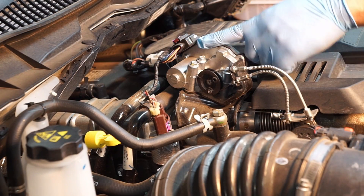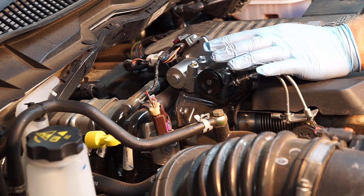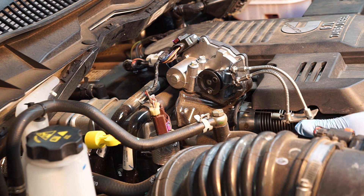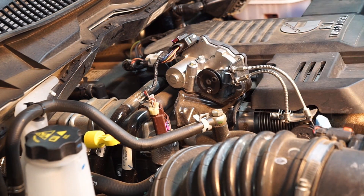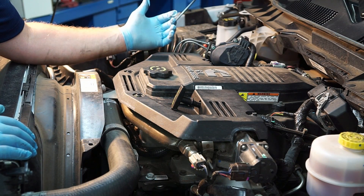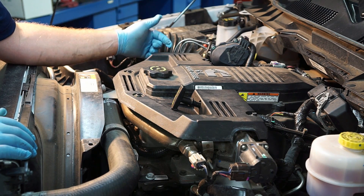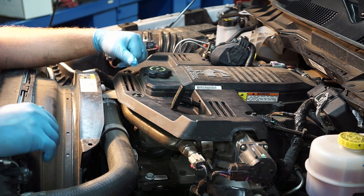On the side here we've got the EGR bypass solenoid and control assembly. A series of cables goes over to the side and there's a valve internally. During events like regen, we don't want those extremely high gas temperatures going through the EGR valve, so it blocks off and plugs the EGR flow to help protect the intake system.